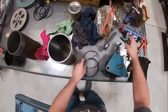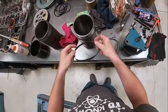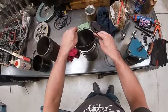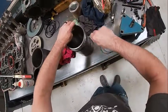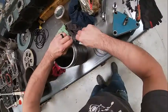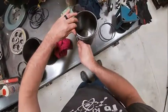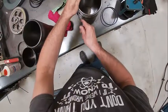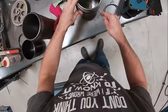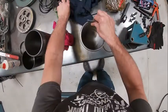When you put your liner O-rings on, this one goes first — it sits right there. This one's not directional. You want to make sure that you don't roll them; you want to walk them on like so. If you actually roll them on, it makes the O-ring bigger and it won't fit.